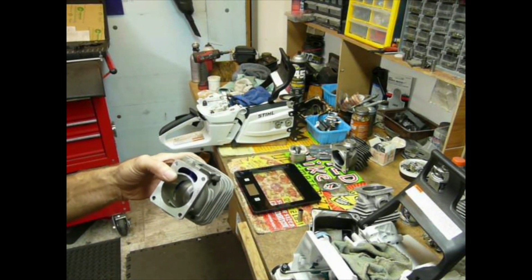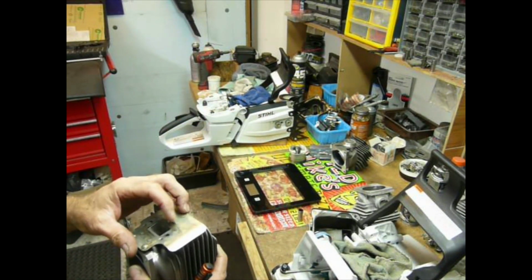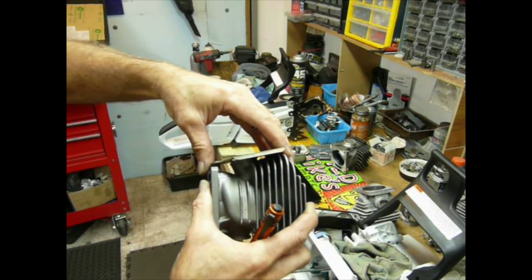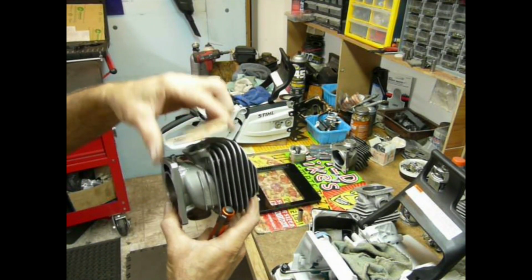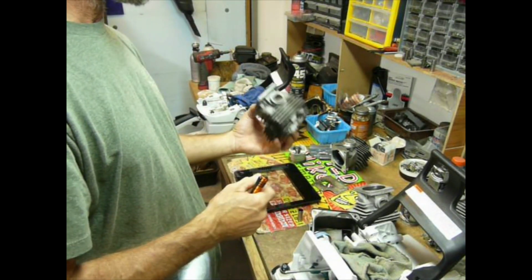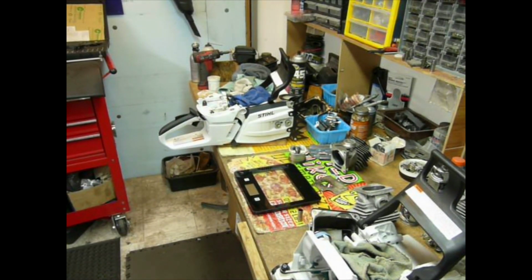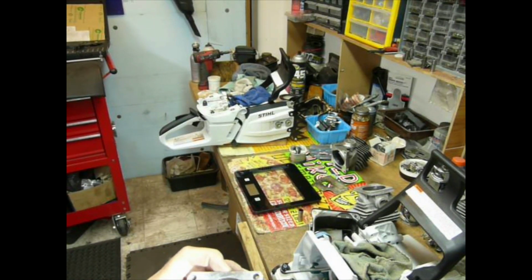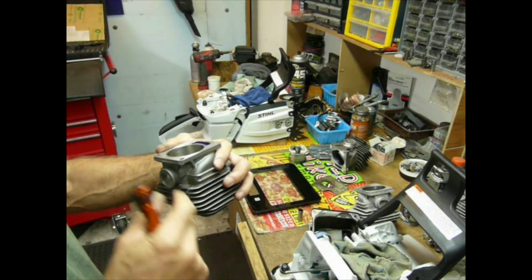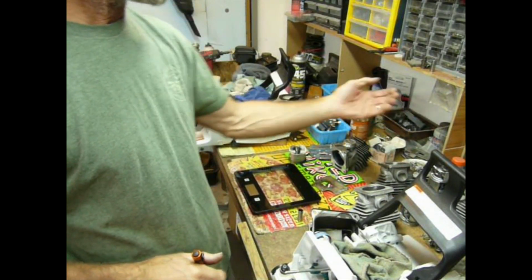The other thing I noticed is that when you have the cooling plate on there, it has a tendency to interrupt the piston. There's a big gap here because this little tang sticks out too far, so you've got to modify that. It's in the process. As far as the transfer ports go, if we look down in there, we can see they're a little bit nicer. They're a little more rounded. But it's got a pretty small combustion chamber. The exhaust port's nice and wide. It's basically a carbon copy shape-wise of what we see with the standard version.